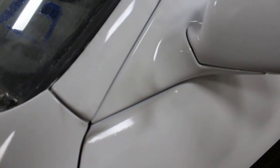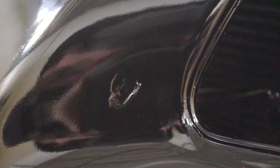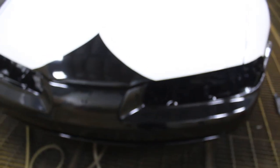The car's been running in a bake cycle at 55 degrees for about half an hour. Normally before you start unmasking you'd wait till tomorrow, but I'm really impatient. I was expecting a bit of black overspray to come through the gaps, but there's a lot more of it than I was expecting — look at this area around the door. The paint had to get in and then blow all the way up and come out around the mirror. This will all just polish off pretty easily, but I'm surprised at how far around the car it made it. I also forgot to sand a bit of bog on the front — looks like it's got a big pimple now.